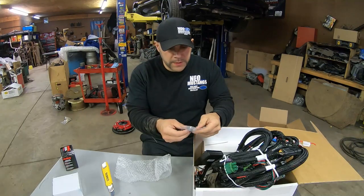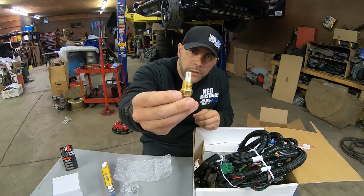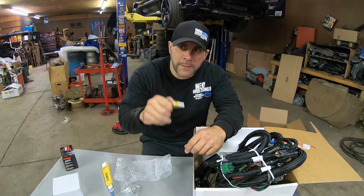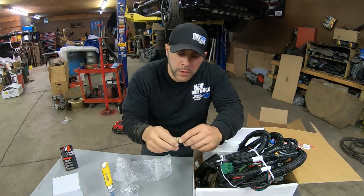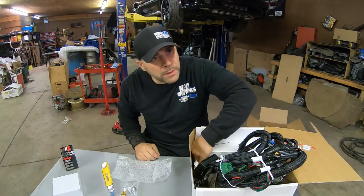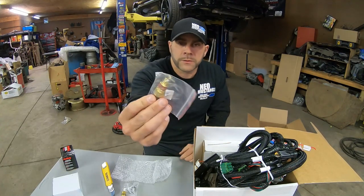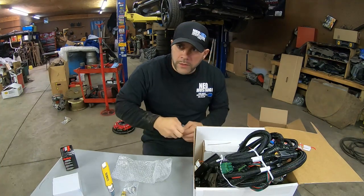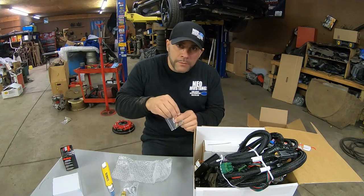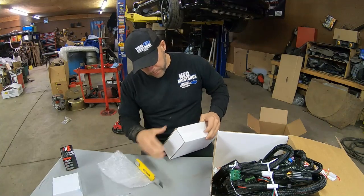Now this is an 18-millimeter bung, so it has to go in your downpipe or somewhere it fits. This is obviously an air intake temp sensor - this is what's in your number five runner on your fox body Mustang. It sniffs the actual temperature inside the intake itself. On my SCT BA 5000 this sensor is actually on the mass air sensor. This is definitely the engine coolant temp sensor - the sensor usually found in the heater tube on the passenger side of the lower intake.